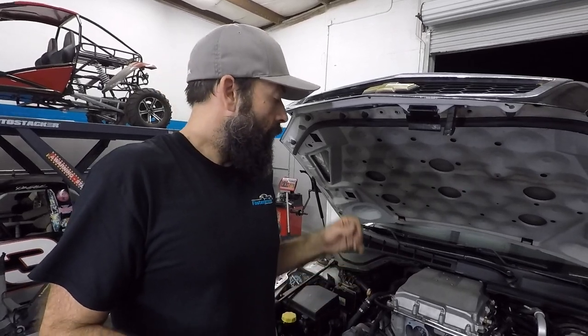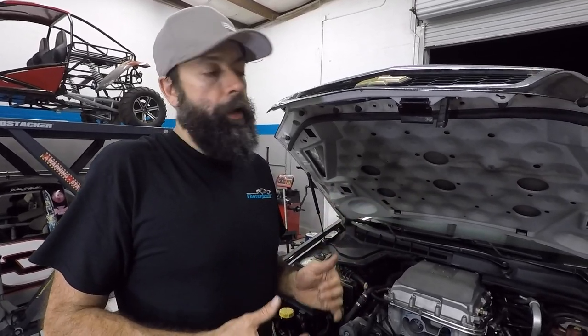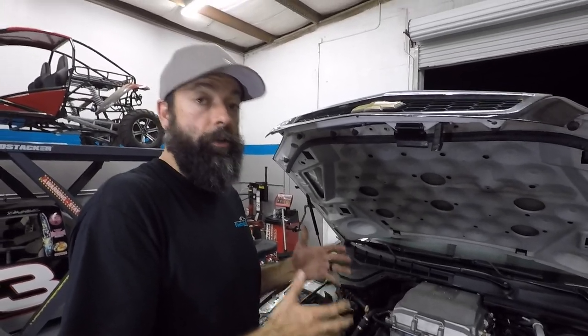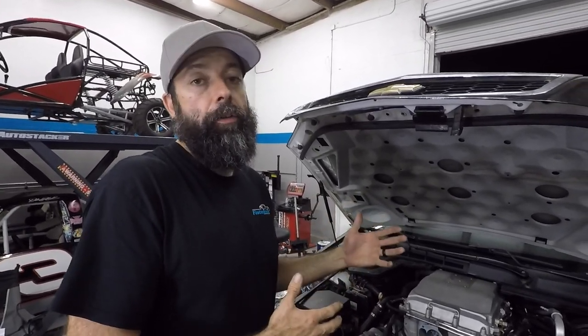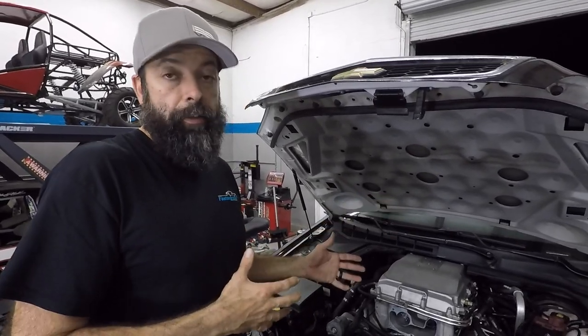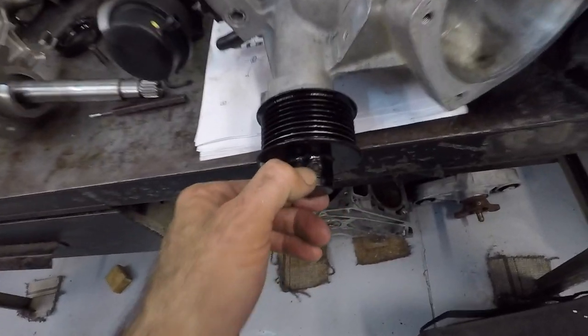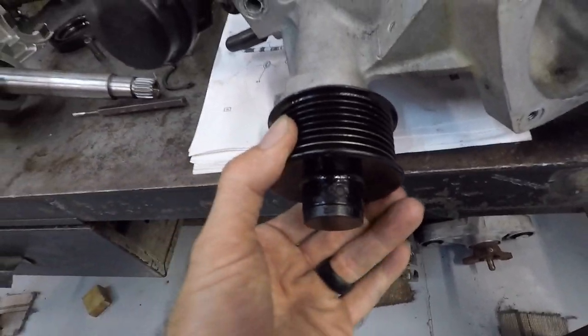What we're trying to do is get a 1.9-liter blower to flow as much as we possibly can. When we're done with this blower, our 1.9-liter ported blower basically flows somewhere in the neighborhood of like a 2,500 blower. The ZR1's 2,300 blower, when ported, flows something like a 2,700. So there's more low-hanging fruit with this blower — the gains are greater than a ZR1 blower. We've seen the ZR1 blowers pick up about 35 wheel horsepower; these many times pick up in excess of about 50 wheel.